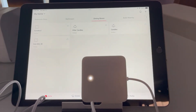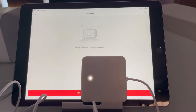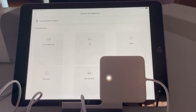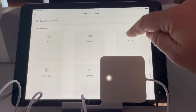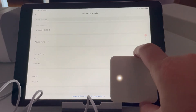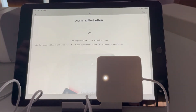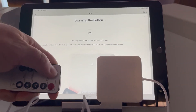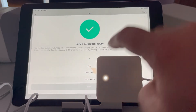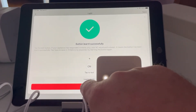The next step is to set it up to work with my candles, and for that I just need the remote control that came with them. I'm going to click into the hub I just set up — it says we have not added a remote control. I'm going to click the red button at the bottom where it says add remote control, then scroll and set it up as a light, and hit start smart learning. It says fail to find a brand, try customize — I'm going to click that. I'll tap the on button, and then with the remote that came with my candles, I'll click the on button. You'll see the light flash and it says it learned it successfully. Now I can tap the button to test it and see if it turns my candles on — which it did. I'm going to hit save.